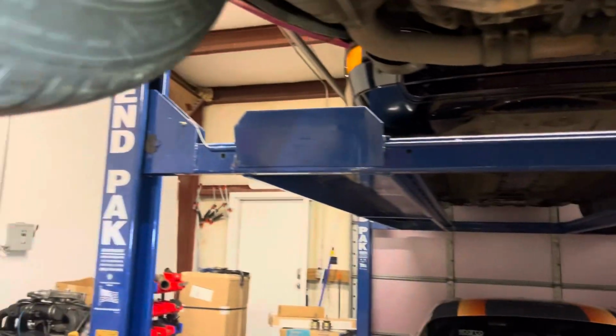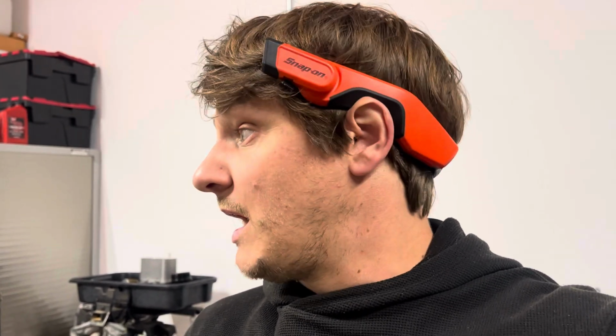The rattle that you noticed in the door is not that flap that's broken, because if you hold that flap, the rattle is still there. So the rattle is probably going to be a loose screw on the speaker cavity. I can pull that door panel off and look. I'll be honest, I have a similar rattle in my car, but it also has stiffer engine mounts, so everything rattles in it. And I had a couple of loose screws. I'll take a look at that and see if I can fix it. I'll let you know, but I'll have to take the door panel off.